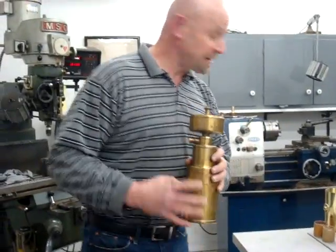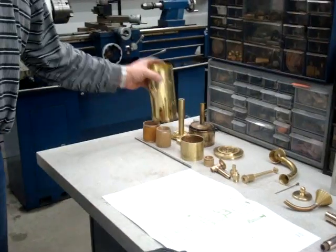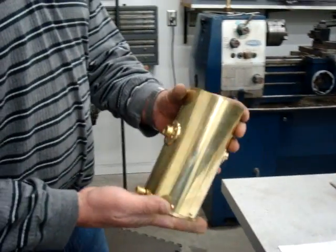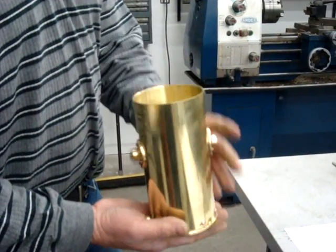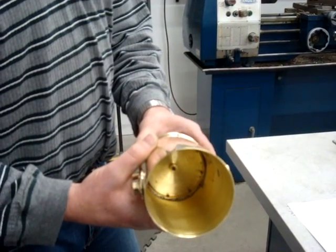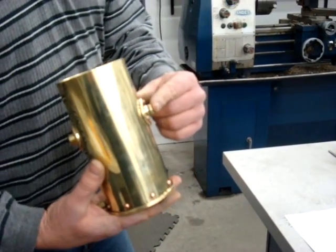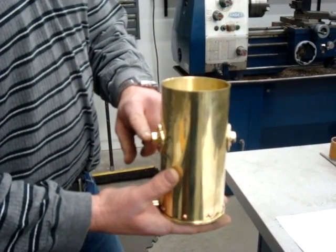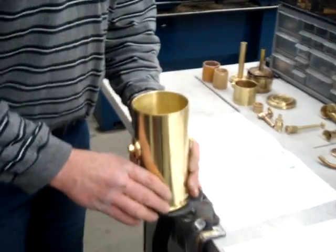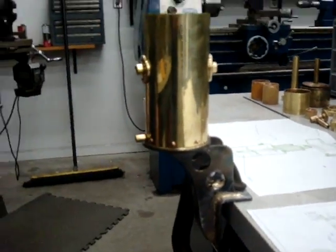What I'm going to do here is show the parts as we assemble them inside the flash carburetion system. The first part is the fuel chamber — it's where the gas is bubbled through the bubbler. This is nothing more than a hollow tube with a riveted base and a drain. This is for the fuel fill and for the overflow. I'm just going to assemble it on the actual mounting bracket that's used for the engine.